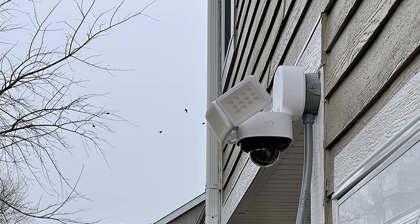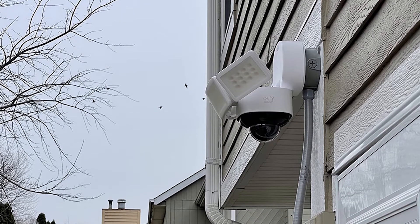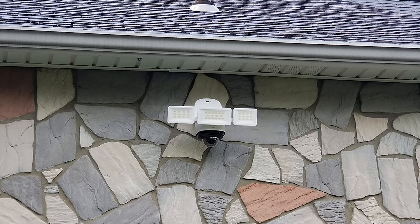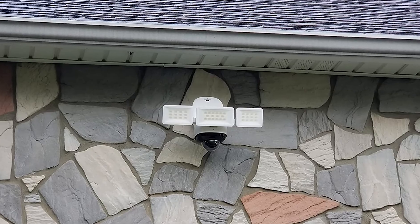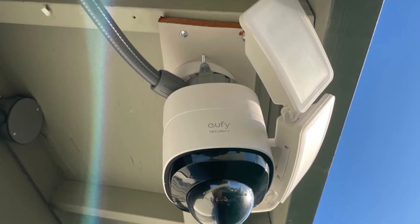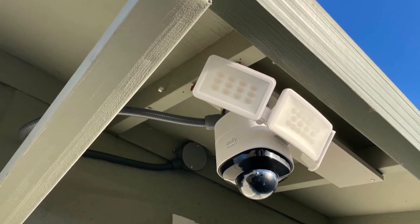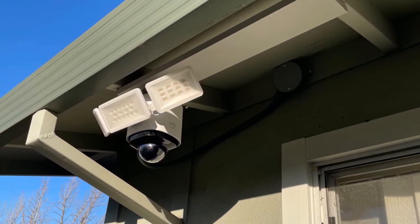If it does not turn blue after a minute, go through the setup process again to reconnect to your Wi-Fi signal. Make sure the camera is getting a good signal from your router — it is recommended to have at least two signal bars. The camera may have been disconnected from your Wi-Fi network; press and hold the reset button until you see a blinking blue LED and hear an audible tone. Limited internet bandwidth — for example, other video streaming services running simultaneously — can cause congestion, slowing upload and download speeds. If the camera's Wi-Fi signal strength is less than two signal bars, you may need to install a Wi-Fi repeater or extender to boost the signal.